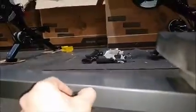If it's a case of the sensor not detecting this magnet, then you have to pull this out and adjust the amount of the magnet sticking out. So here I'm just pulling it out a little bit, and you see there's still some clearance and my console is counting, but this one is already working, so just one point to play with on this to check for issues.